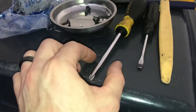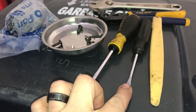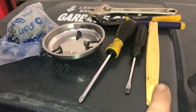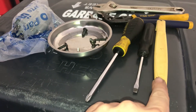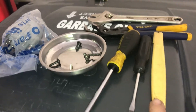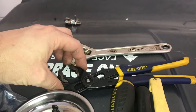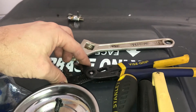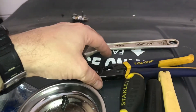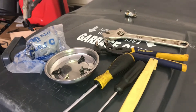You're going to need a Phillips head screwdriver to take out your Phillips head screws, and a small flat head screwdriver to allow us to pop open the light switch — I'll explain that later. You don't necessarily need a trim removal tool but sometimes that helps when prying open things and not damaging them. Then you want to get yourself an adjustable wrench or some adjustable pliers. It does not need to be a socket wrench; you can easily get them with this. It's not something that needs to be tightened up tight.